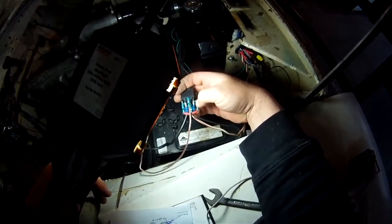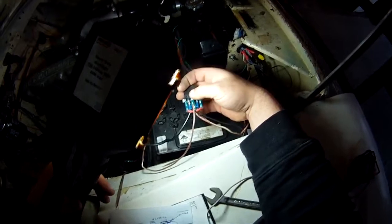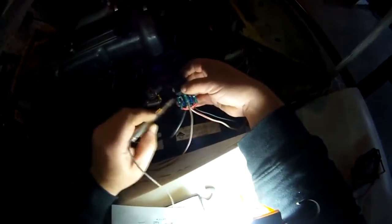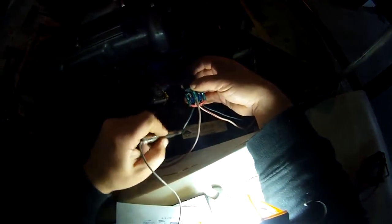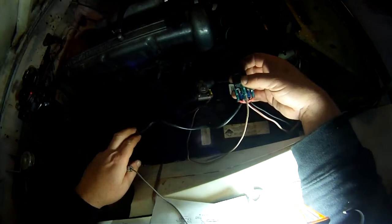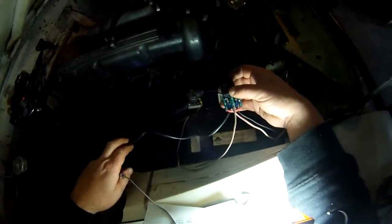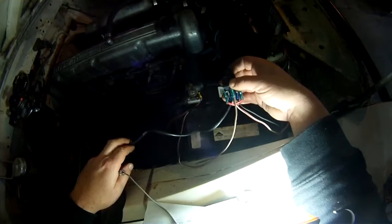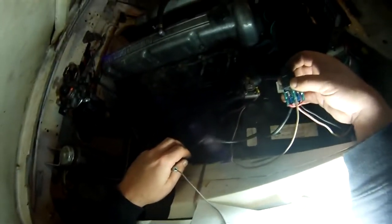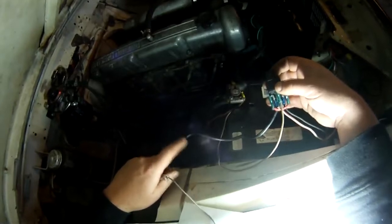The diode is in there as shown. On pin 85 we've got the positive from the ignition switch, so with the key on that will be powered and with the key off it won't. You need to find a source in your wiring that does that — I traced back through the switch and found wiring that will do it and pulled the feed from there.